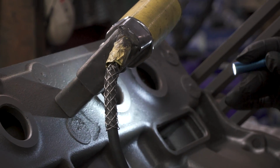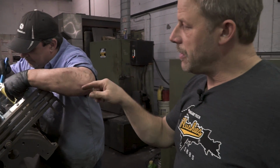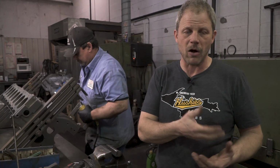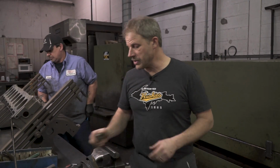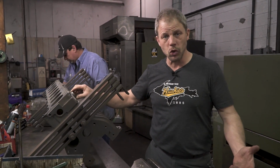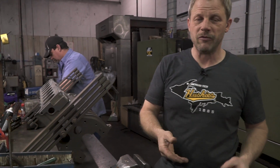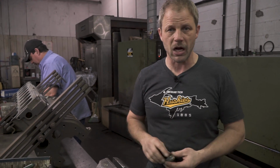I know we've been asked in the past, well, why do they even need freeze holes or these holes in the side of the block? Well, the idea behind, they're really twofold, freeze plugs in general, but the holes are on the side of the block. When the blocks are cast, they're sand cast, and you have to have a water jacket. How that water jacket is created is you have a core of sand, hard packed sand, that is in there. After the block is cast, obviously you have a hole so you can get the sand back out. Now, these are called freeze plugs. They pound in, they seal up the block relative to the coolant, but then at the same time, by the name, freeze plugs, if the block freezes, the idea is the water will push these out as opposed to cracking the block.